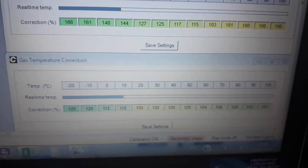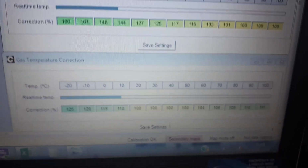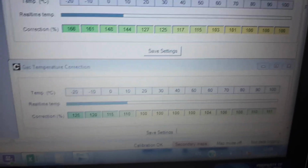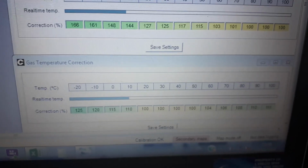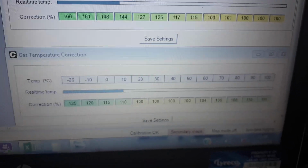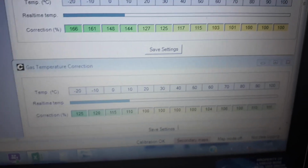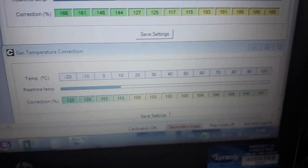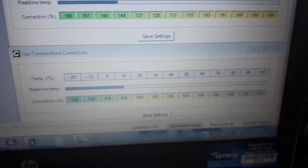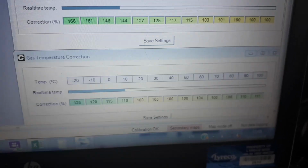Just like when you spray deodorant on your arm, when you release a liquefied gas, it tends to freeze and gets very, very cold, because as it expands, it's boiling at minus 40 degrees C. In fact, that's LPG once you release it from its liquid state into its gaseous state. That's why you need coolant running around your vaporizer if you're running a gaseous system, and that's why it can be a bit difficult to cold start LPG vehicles in cold weather.